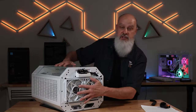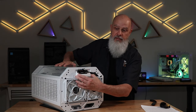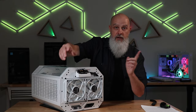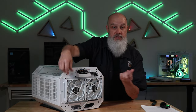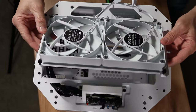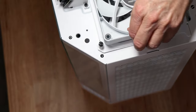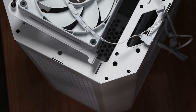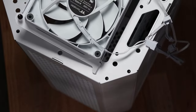I've laid the case over on its back, and this exposes the top fans and the I/O panel. These fans are mounted to a cage, and we can go ahead and remove that cage as a whole assembly. There are two thumb screws, one on each side. You just loosen those up, kind of lift it out, and there are two tabs in the rear that are engaged. Just pull that up, and the cables are initially inserted down in the back, which you can take out.